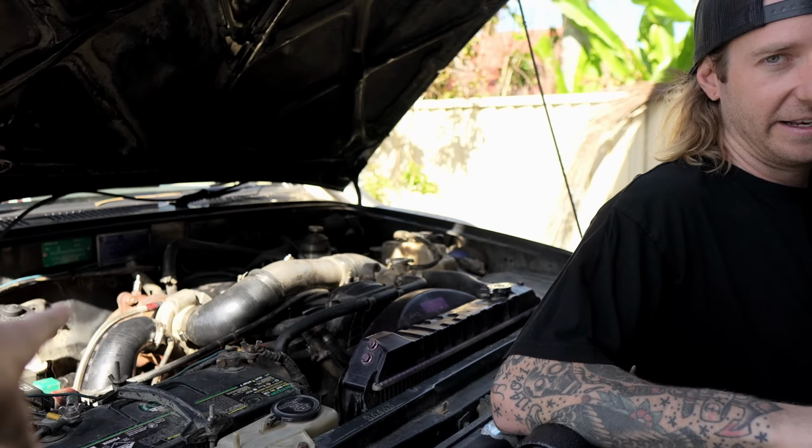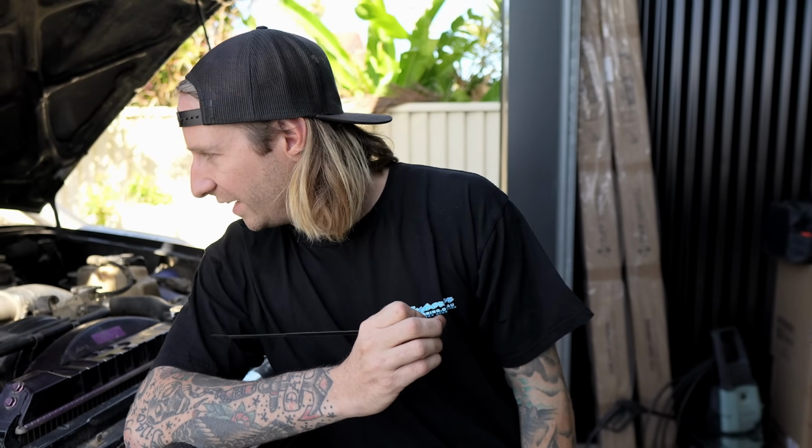The main issue we have found is the 80 series booster, which we ordered off Bendix. Absolutely perfect for an 80 series, but because Bendix sells upgrades, it's a bigger diameter. Either that or we ordered the wrong one, I don't know. Either way, it was a lot bigger. Doesn't fit in an LN. Then we tried the 79 series one, and that didn't work because the vacuum hose was pointing straight at the dump pipe.